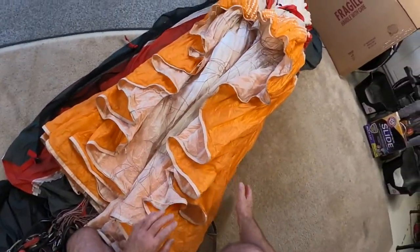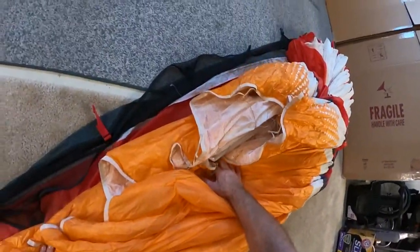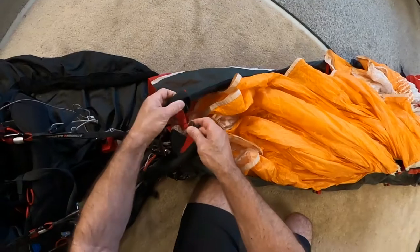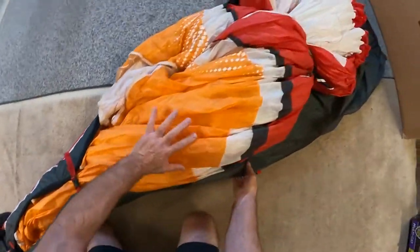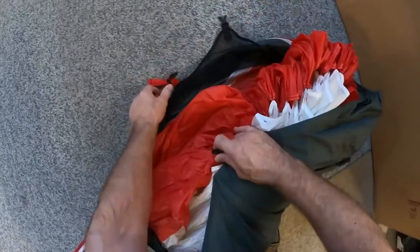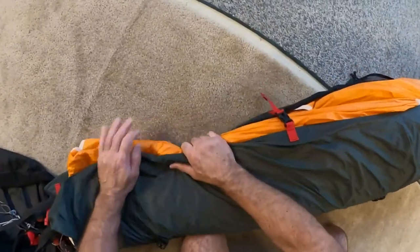And that's it. Then at this stage I just kind of put this one on top of that one. Then I'll start at the bottom and connect her up. This is where I put my brake handles in the first connector. Then as I'm working my way up, I push the air out — if you go the opposite direction, you're going to trap air down on the bottom. Okay, that's the first connection. I'll turn it on its side now, run the air out, and put my other snap on.